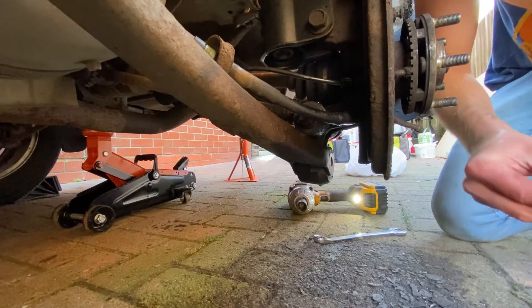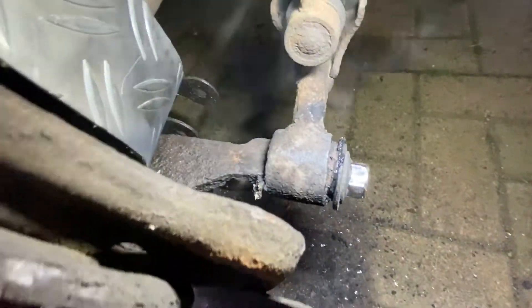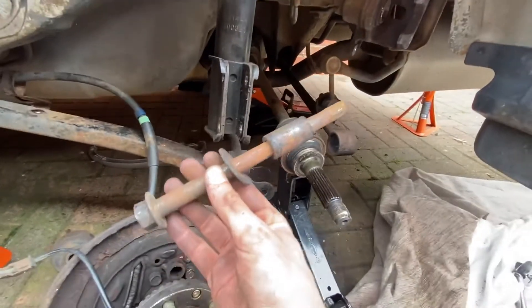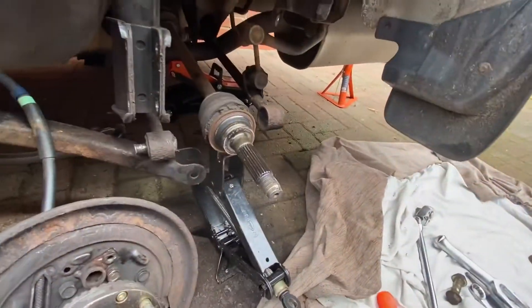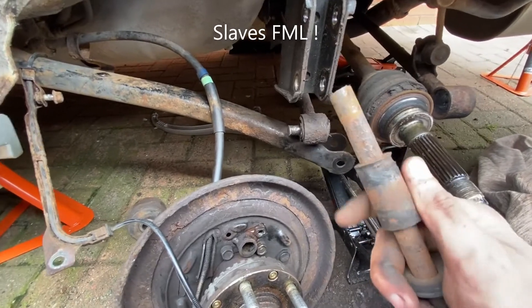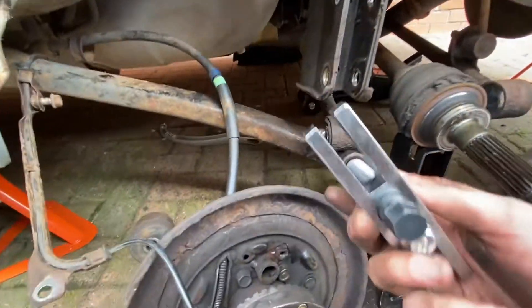I've jumped to plan 2051 — I'm burning the bush out. I need to be careful: I put this aluminium plate here so I don't burn the CV boot. And then we've got another bush in here on this side, which I've been trying to burn from the back. And it seems like it's working. Would you look at that — I managed to get it off! It was C-clips on these sleeves, as you can see. The other one is still there but I can just press it out, so there's not a big issue.